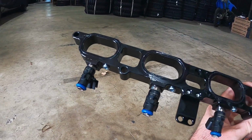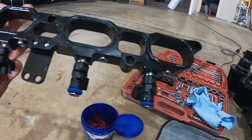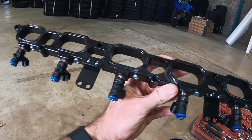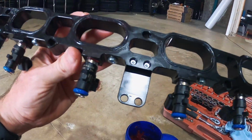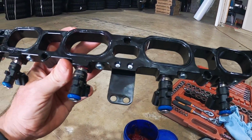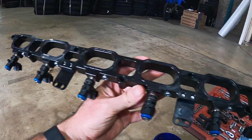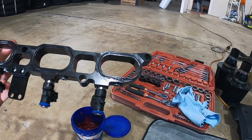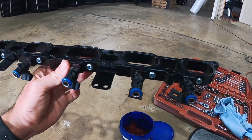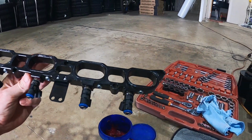Okay, scrap that last take. I'd forgotten that the O-ring setup on these port injection rails is the craziest thing in the world. And of course, 3 of the 6 O-rings were not seated properly when I just went to double check. So I've taken them off again, and they're starting to swell. They're sitting in place, but it's a horrible design. I'm just going to buy a different intake manifold as soon as I get the spare cash, because this system is just too easy for these O-rings to not seat properly. Wish me luck, guys.